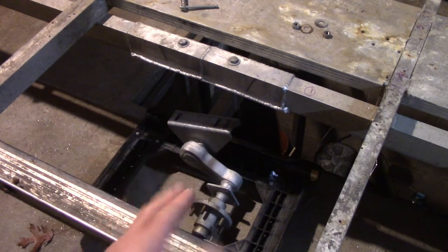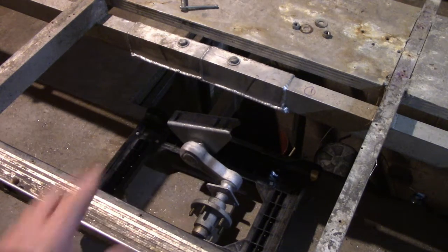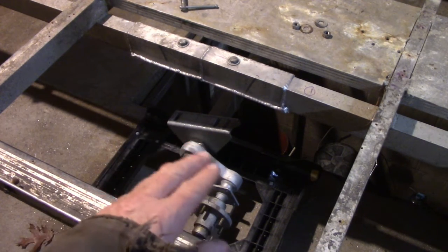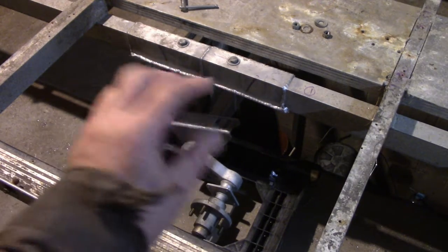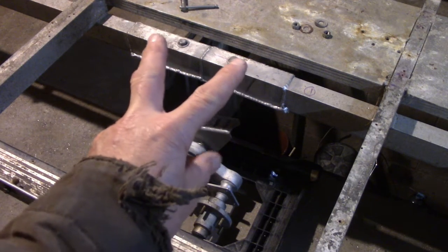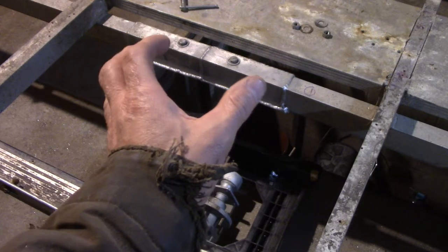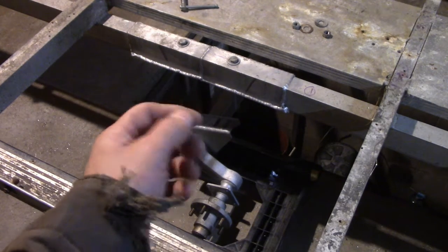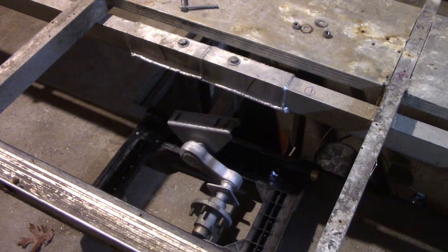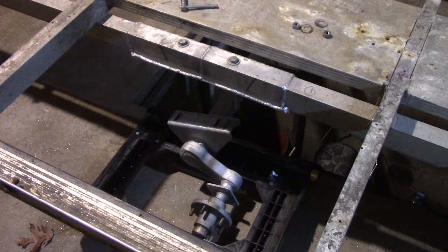So I got the frame all boxed in and ready for this axle. Before I jack it up — this is galvanized steel on aluminum, and it doesn't interact well. The original axle when I took it out the first time had a metal piece on top about a quarter inch thick, and that top piece just buckled. The Alka-Seltzer deal — aluminum and steel — it literally jacked the thing with corrosion pressure. I couldn't get the bolts off and had to cut them. So I'm going to throw barrier gorilla tape on this to help with that steel-on-aluminum issue, or use a little rubber to create a barrier. I ended up using a bicycle tire tube — just going to slip this down here as a rubber barrier between the steel and the aluminum.